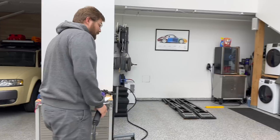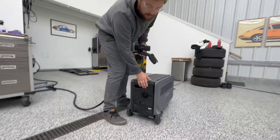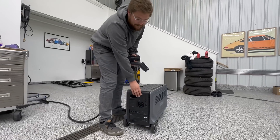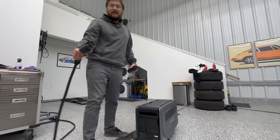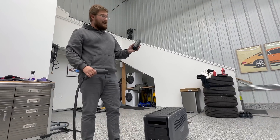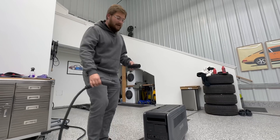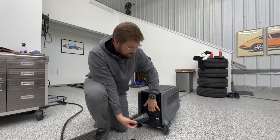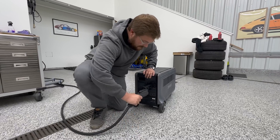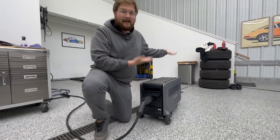In the back, this little port is what they're calling the ZenCharge port, and inside is a European Type 2 connection. In the US we use Type 1 — J1772 — and they provide a T1 adapter. What I do is plug the T1 adapter into the port, then take our Autel charger here at the shop, plug it in there, and it charges.